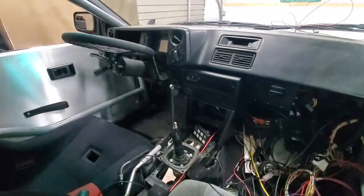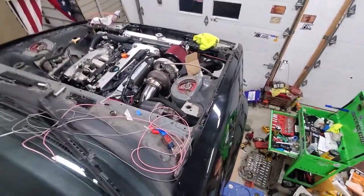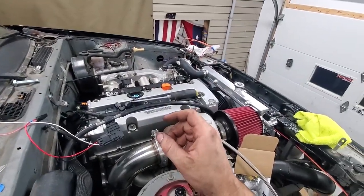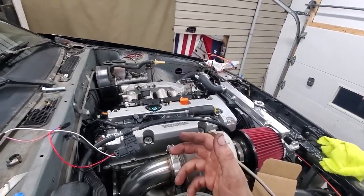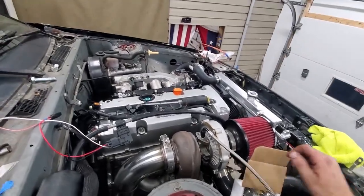There's the push button. The key controls the ECU and the PDM. I've gotten to learn the Haltech system pretty well from messing around with it - it's actually pretty easy once you understand it. All that's left is to program the fuel pump to come on when you turn the key on, but I want to put fuel in the gas tank before I do that so it doesn't run dry. I need to hook these wires up so we're not spewing gas on the floor. Boost solenoid, a couple vacuum hoses, random stuff, and we're pretty much good to go.